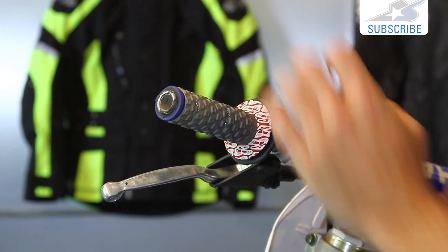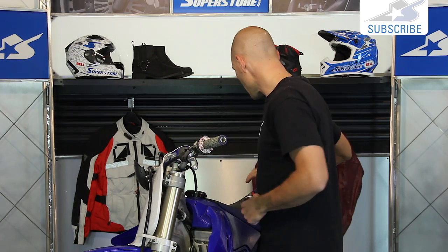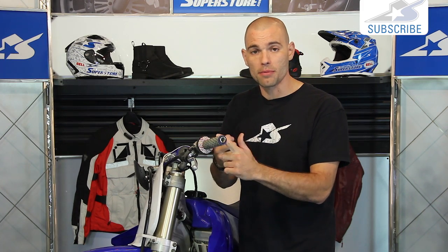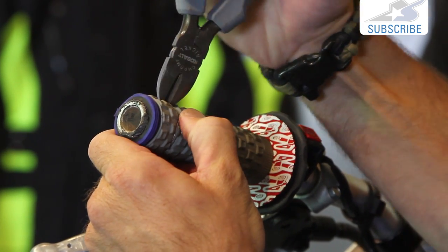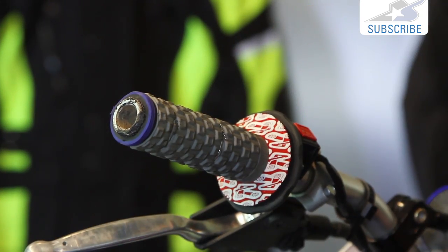Getting the grips removed is actually pretty easy depending on which type you have. Aftermarket grips are probably loose and easy to pull off. However, if they're your stock grips, those are vulcanized on there — they're probably not spinning, just worn down — and you may have to use a box cutter to cut them all the way off. This one already has safety wire on it, so we'll use our dykes to remove that first. If you're trying to reuse these grips, be careful not to cut big chunks in them as you do this. Then we'll take our small screwdriver — all of these are double wrapped.